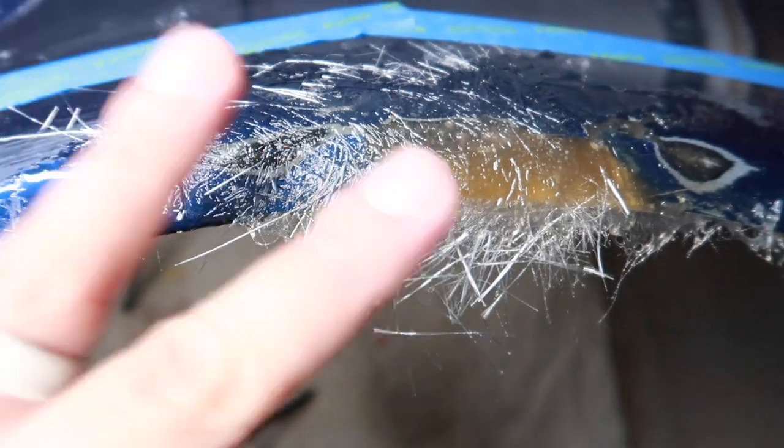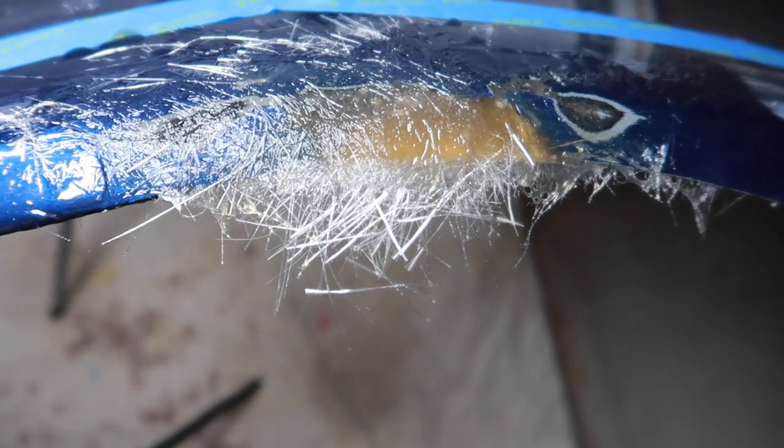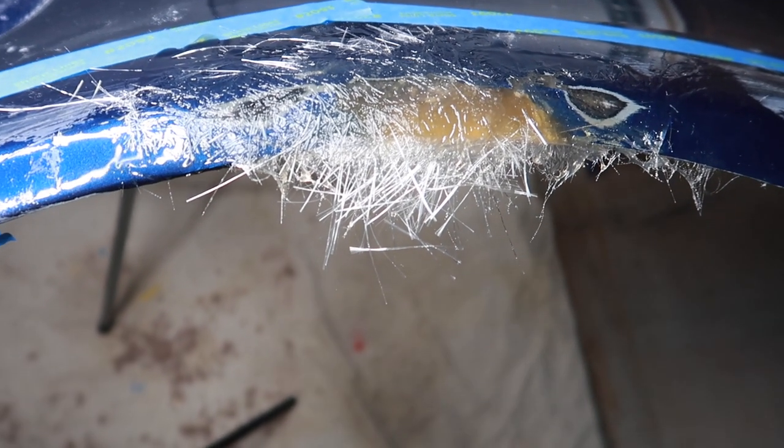So unfortunately this may be a three-part series. The resin right here with the fiberglass is still soaking wet. We did leave it outside. The weather isn't the best in Albuquerque right now. It's about 35 degrees and resin usually hardens around 75, and it would have been a lot quicker. So the warmer, the better. So unfortunately, this may be a three-part series, and hopefully in the next video we can get to sanding.